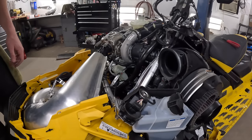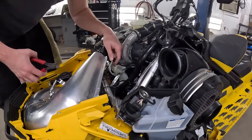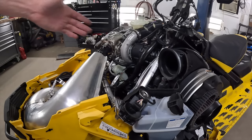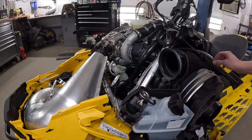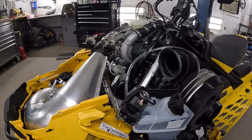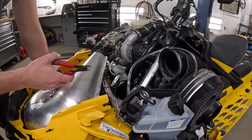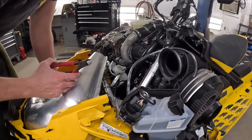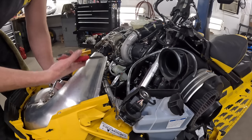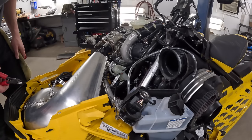This just kind of made me a little, not mad, just annoyed, I guess. So I went through all that, taped that up real nice with the heat tape so that the pipe can't bother it. Routed it in a way that makes a lot of sense, it's very simple, right? Downside, I'm about a foot too short on the rubber hose here, or not even rubber, whatever this is. So I'm gonna cut this off, take it off of the junction where it adapts to the black rubber, and then I'm gonna use some of my Vibrant silicone vacuum hose that I keep in stock. You can use their supplied hose, but you're gonna have to route it somewhere else. I'm still gonna route it this way, but their supplied hose is too short to run it the way that I would like to. So it is what it is.